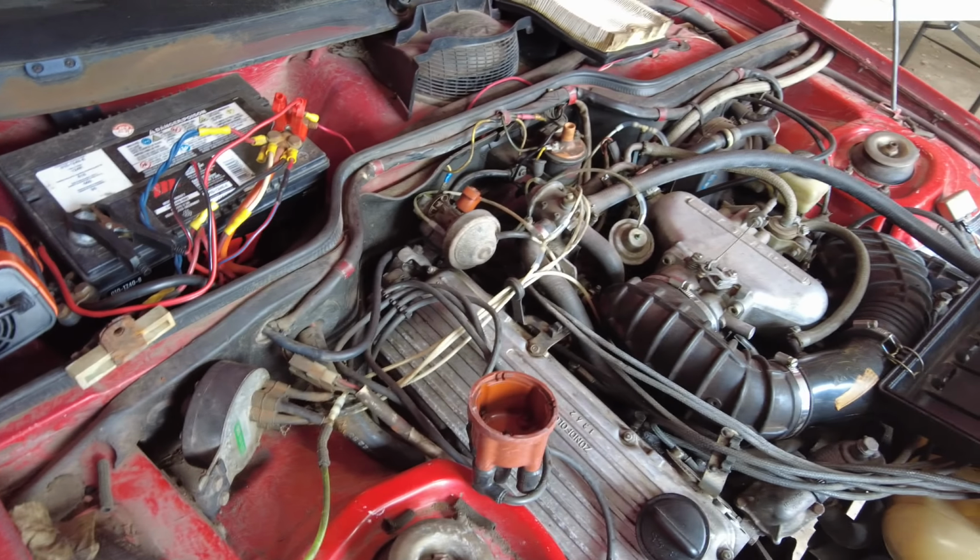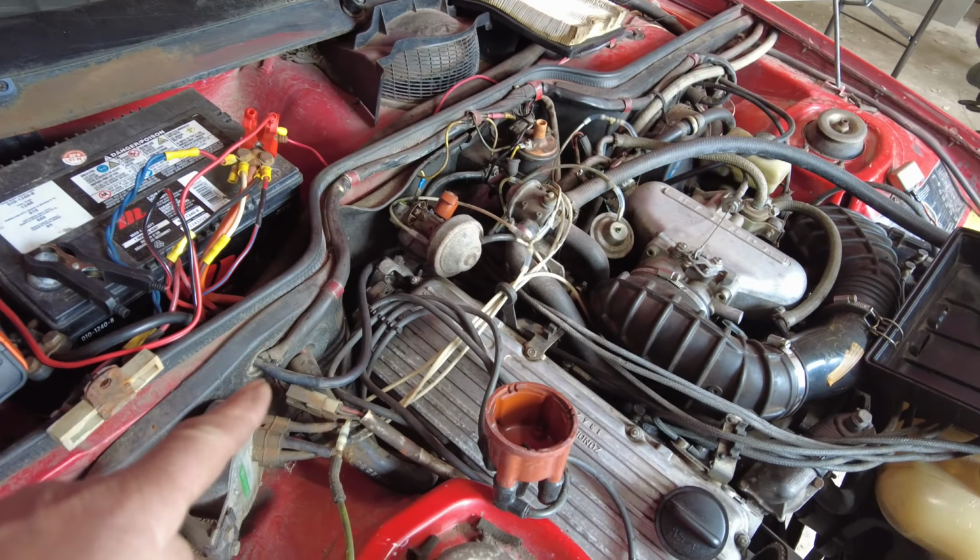Yeah. So now, in here, I think I've got the fuel pressure working right. Now, the next thing is underneath. I've taken the distributor cap off, and down in back there, there's a thing called, oh, what's it called? It's called a cold start thing. These two lines here go to it, that line and that line. So now, it can be a problem, so I'll pull that off and see if it is a problem.